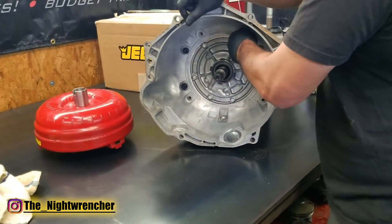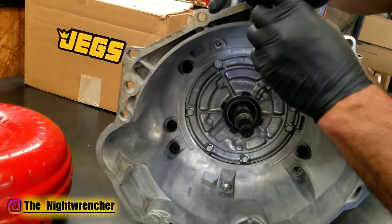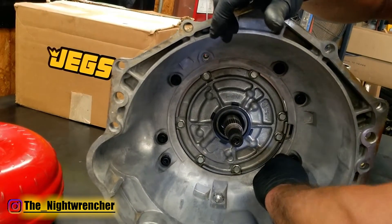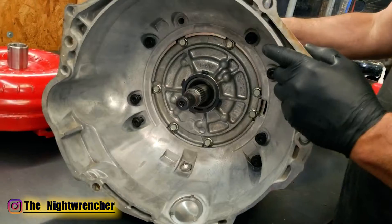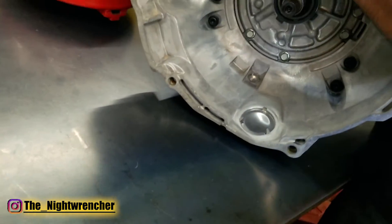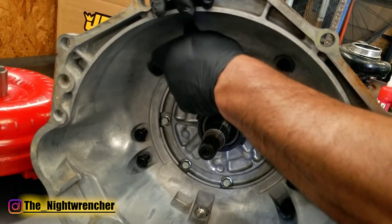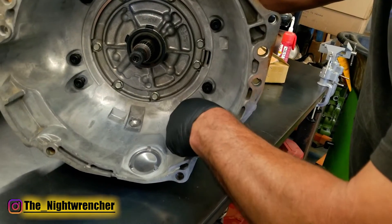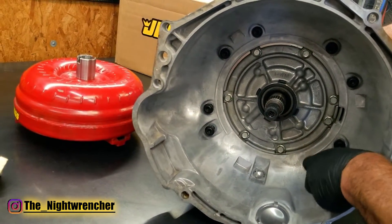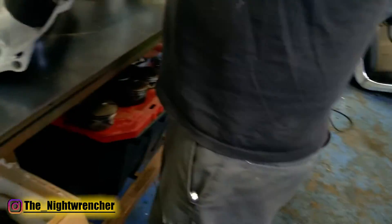Now that we've got all that out of the way, let's flip the engine over. Anthony is over on the bench finishing up the transmission. This is a 4L60 — it's got a SunShell in it, it's got Anthony's own 3-4 clutch stack, it's got a TransGo Pro shift kit, and it's got a 500 boost valve from TransGo, hopefully to hold some power. Any particular reason we're going with the 4L60 instead of the 4L80? Right now this is pretty cheap to do — a 4L80 requires changing the driveshaft and a bigger shaft, and depending on your setup it could make you have to hammer the trans tunnel. We already have a 3,200 stall converter for the 4L60, so this is the cheapest most effective way to get this thing finished.